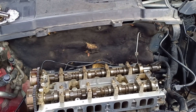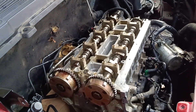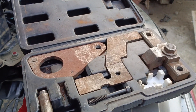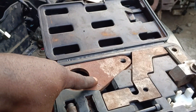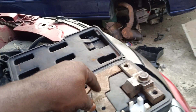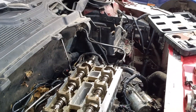Hello guys, this is Miami Automobile Technical Services. Here we have a Range Rover Evoque. I want to set the timing on this Range Rover Evoque and I have my timing tools here. This one is for the block engine, this is for the pulley, this one also for the pulley, this one goes for the camshafts, and this one goes for the flywheel.